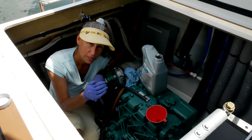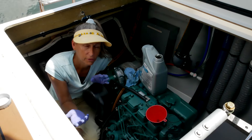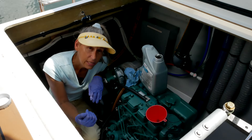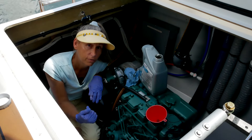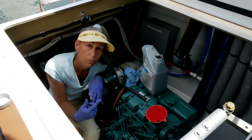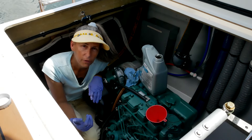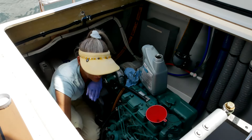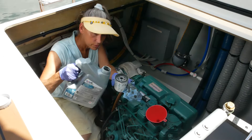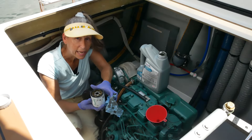With these engines and side-mounted oil filters, you can't put a huge amount of oil in — it'll just pour right back out. But it is important because the oil pump is going to have to fill that filter up, meaning the engine will be starved for oil during that time. So the more you can pre-fill the filter, the better. I'm going to pull the oil filter back off and just pour a little bit of oil in — that's probably enough, just enough to get it going.